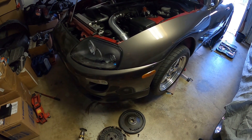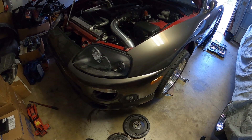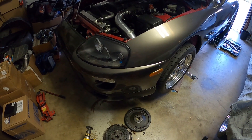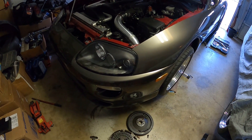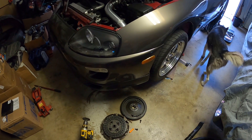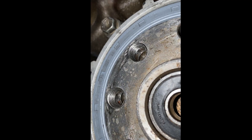So I decided to try and tap the threads out again. Of course you have to put a lot of grease around the tap, because if you don't, you run the chance of metal shavings falling into the back - that gets sucked up into the oil and can cause catastrophic failure. I was moving maybe a quarter of an inch at a time, barely even that - making one thread, pulling back, making a second thread, pulling back, making sure there were no metal shavings going in. From the next picture you can see I created the threads that were gone, but since the bolt was angled down, it had damaged the threads in the back too - there are some flat spots there.